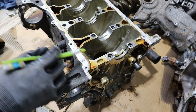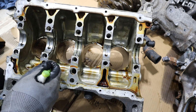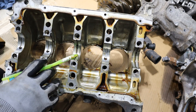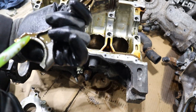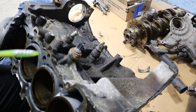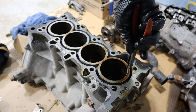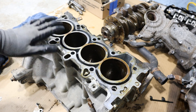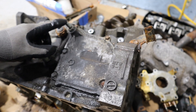Oil goes into the pan where it gets filtered and sent back in through this hole, which corresponds with an oil galley drilled across the length of the block to feed all the crankshaft bearings as well as the connecting rod bearings through the crankshaft. There are no piston oil squirters for cooling and lubrication; instead there are little notches on the connecting rod itself that spray oil upward to help cool the cylinder liner. Teeing off the main oil galley is an oil feed going to the head at the interface of the head gasket, with a piece of plastic sitting in there. This is also an open deck design — very good for cooling. Since it's a low power engine, you don't need supports between the cylinders.